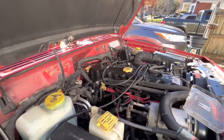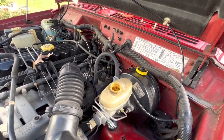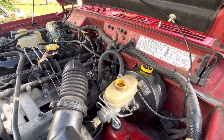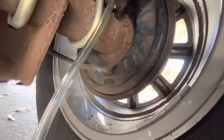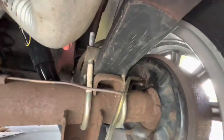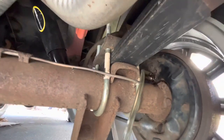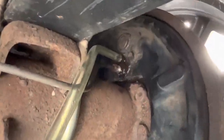I'm going to add brake fluid and fill up the reservoir. We're going to pump the tire furthest away — I've got a vacuum extractor and we're going to pull all the dirty fluid out of that line hopefully. I've got the vacuum extractor hooked up. This is a five-sixteenths size nut. Let's put the vacuum on it. We've got a lot of air in the system because of the fact that we replaced the brake lines, so we're going to pull a lot of air out. Just keep doing that.